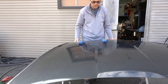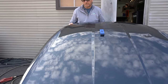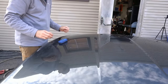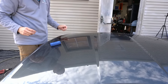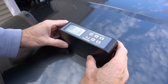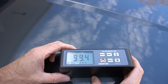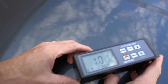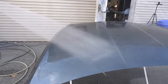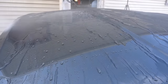Here is a quick visual that will give you an idea of the slickness. Gloss is off the charts for a coating that is entering the curing process, and that will only increase into the triple digits as the curing process goes along. I have to hold the meter or it will just fly off the panel. Super hydrophobic — and it's also easy to dry with forced air.